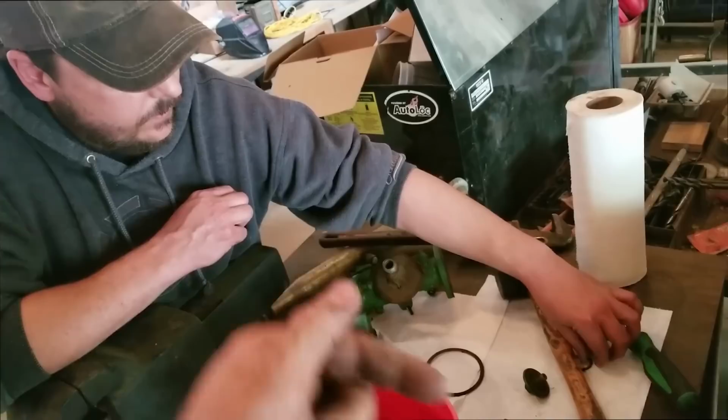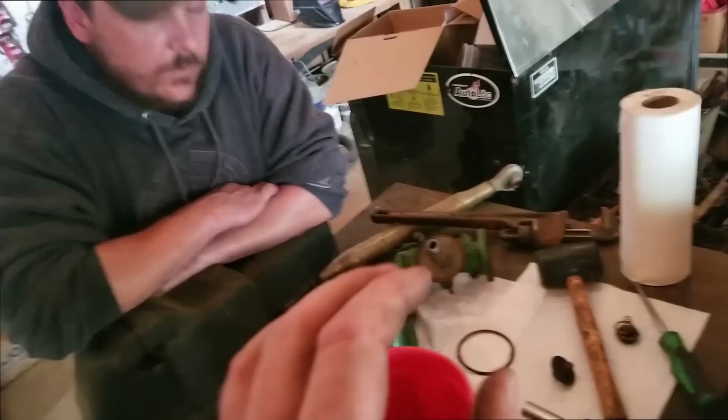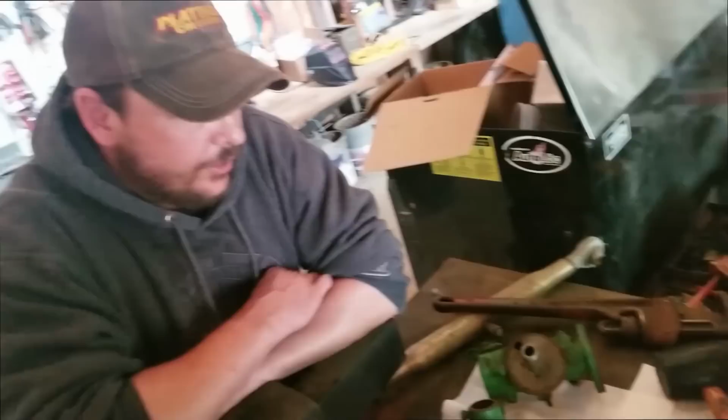Put it down here. We would be thrilled to put one on the tractor, but the only way I know how to rig one up is with an electronic solenoid, and we really don't want any new technology within eyesight where you can see it. We want to stick with old school stuff. So right now we're probably just going to put a hand shutoff valve and hope everybody remembers. If not, we'll be back draining oil out of the... Well, with you here, you should be able to start it up and let it drive once a week. So we'll know. We will. And then we'll shut it off and run the fuel out of the carburetor bowl. So we'll leave it running until it's dry.